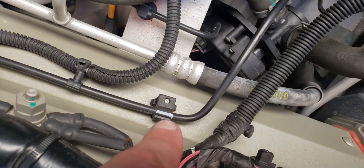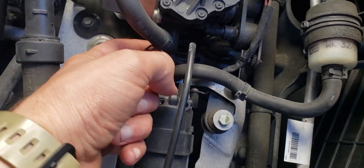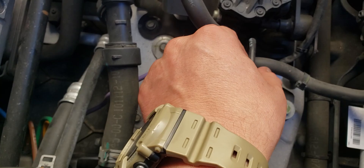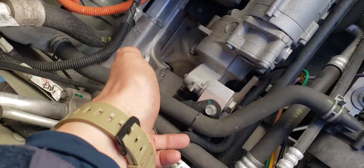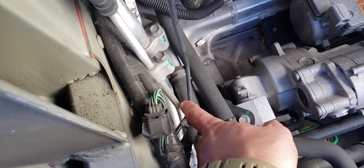See this one right here — everywhere the line is, there are marks where the clip is going to be. Make sure it doesn't touch anything, because a lot of people had problems with hoses touching the aluminum or something else and it would rub against something and make a hole. Right now it's routed so it's not going to do that. I was a little afraid about this one here but I bent it back a little bit, so it's all good.